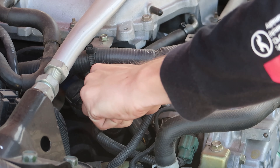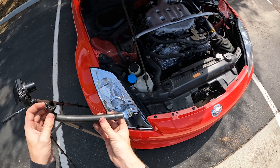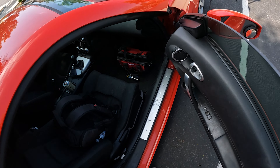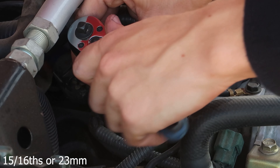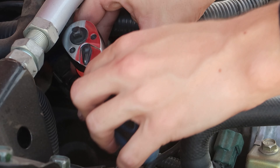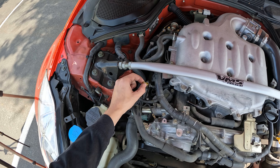We'll do this side first. There's the tube — looking inside, it still looks pretty clear, which is good. It was clear last year when we checked it too. Now that the PCV valve is exposed, there's quite a bit of oil around it, so I'm interested to see if it's actually working. We're using a 15/16 half-inch drive to pull this out. The valve cover this is plugged into is plastic, so when you tighten it up at the end, don't overtighten it or you might crack it — you should be able to take it out by hand.